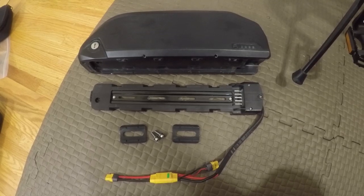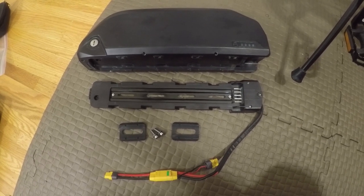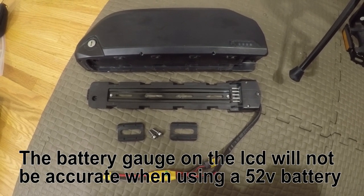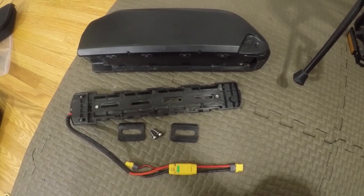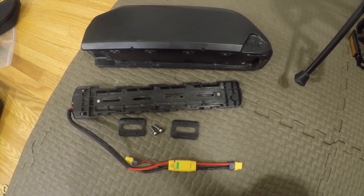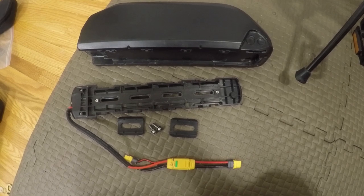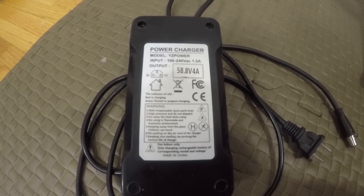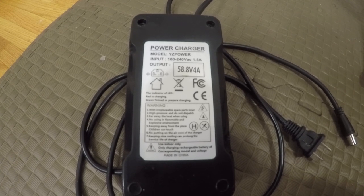You would also need a battery. This kit works with a 48 or 52 volt battery and I have confirmed with eBikeling that a 52 volt battery is compatible. I feel the most expensive part to any eBike conversion should be the battery, so I went with a 52 volt 15 amp hour battery from em3ev.com — and remember to get a charger because they don't include one.